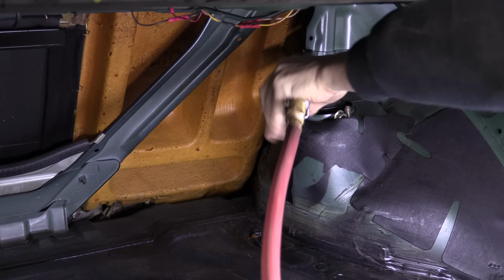It started the chain of parts that I was unable to remove because of just one stuck bolt, and they began to stack up on me. Three 12mm bolts hold the steering valve down to the subframe. One came out without too much fuss, but rust had caused the housing and the bolts to swell so badly that only my thinnest, weakest chrome 12mm socket would grip anything resembling a bolt head. That got the second one, but it stripped the third.